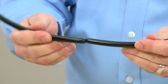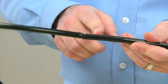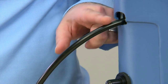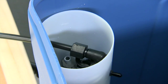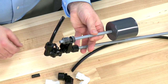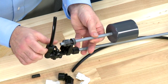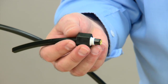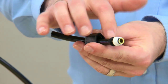Since we are working on a vacuum system, this would make it a challenge for the salt water to come through. We would want to shorten or replace this hose. We then follow the tube into the brine tank and find our way into the valve assembly. Inside the tube assembly, we can follow our hose and find our connection points. As we remove this hose, we again check to make sure that there is no scoring in the ends of the hose.